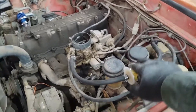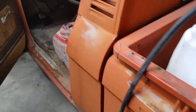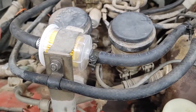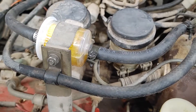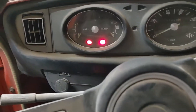I have these crusty lines replaced and the fuel filter installed. Rear fuel tank bypass — it's got it sticking straight in that jug. Now we're definitely down in the fuel, plus it's a racing can, so that ought to help. It's changing tone — that's a good sign. There's some in the fuel bowl. Single pump. Make sure it's out of gear because there's no clutch.